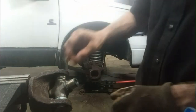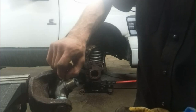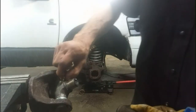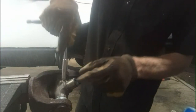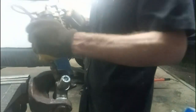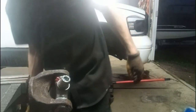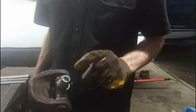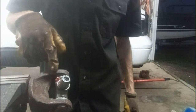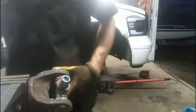It's going to be a better job for no gloves. Guess that's it. Threads aren't really the greatest. Probably put a couple more pumps after once the caps are in there. If you notice, put some grease so it comes out of there. A good tip is to always leave a little bit of extra grease on the grease nipple. That way, next time you can wipe the grease off and there won't be dirt going in there. Otherwise, if there's no grease, there's nothing to wipe off and have clean behind it, if that makes any sense.